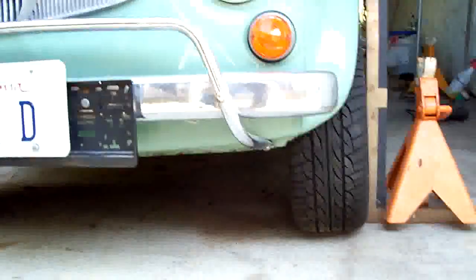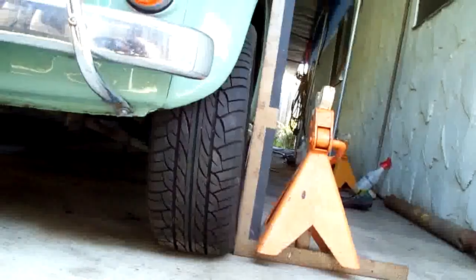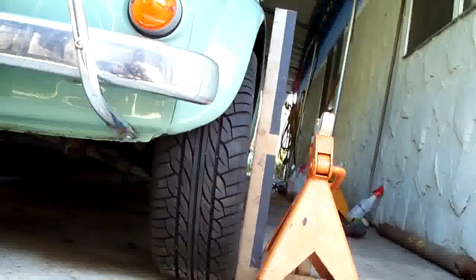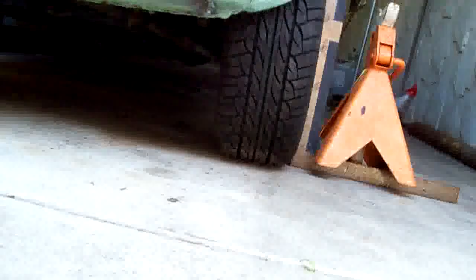I'm going to do a little road test on it, see how it looks. It's raked in, but when you get into a hard corner, that tire is going to become very neutral and it's going to have a lot of traction, because these are pretty wide tires — 175 50 series 13 Sumitomo. And I have the Fiat 850 disc brakes cut down so I could clear some 10-inch wheels if I wanted to run 10-inch.